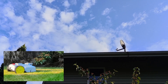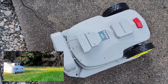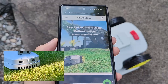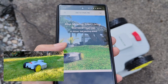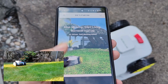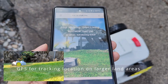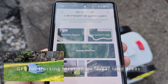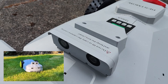The reason it needs a separate GPS component is because it's covering a larger piece of land. Managing larger properties compared to indoor robot vacuum cleaners, it's going to be harder for cameras alone to detect the edges of a perimeter, especially if the lawn surface area stretches on for meters and meters. So for it to have a better idea of the exact dimensions of the land it's trying to mow, that's where GPS positioning technology assists it on top of the conventional camera sensors for obstacle avoidance.